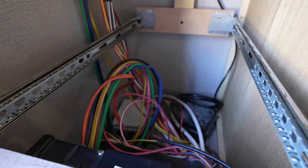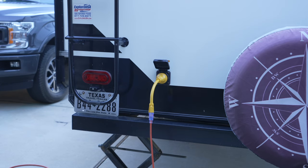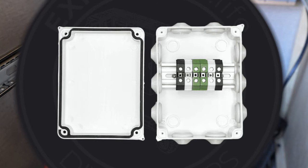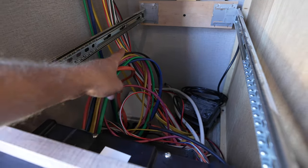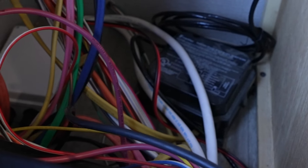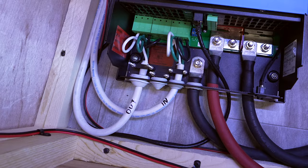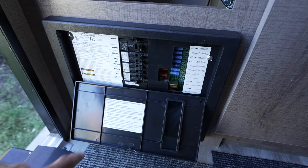One of the things you have to do when wiring in a MultiPlus inverter charger is take the shore power coming from the plug at the pedestal and wire that directly to the MultiPlus first before you come back to your sub panel. Nate from Explorer's Life came up with a new junction box that makes it extremely easy to do — that white thing back there is the junction box. All we had to do was take the orange wire, pull it up from underneath the camper, cut it, then run two new 10-3 wires. You basically have the orange wire coming in from shore power splicing in with one white leg going all the way back to the bed where the inverter charger is, and then a second white run coming back spliced into the orange going to your distribution panel.